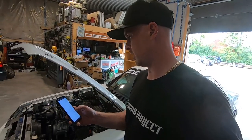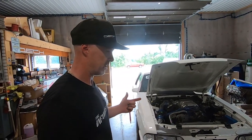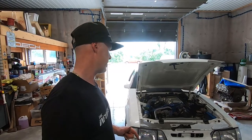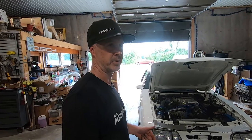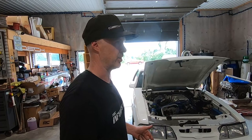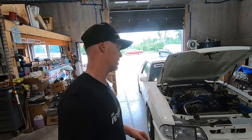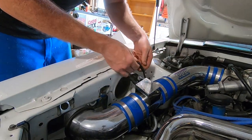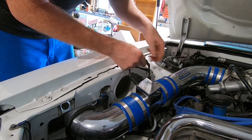Code 91 is oxygen sensor problem, fuel pressure out of specified range, or injectors out of balance — that would explain a lot with my idle issues. Then we have code 33, which is the EGR valve not operating properly. The reality is these are pretty impactful codes — O2 sensors, EGR, coolant temp sensor all mess with how the car operates: dumping too much fuel or not enough. This would explain a lot of the erratic idling behavior and the car bucking a little bit when it got warmer, so I'm definitely going to have to go through and check a few things.